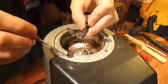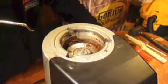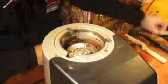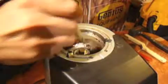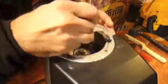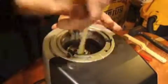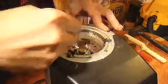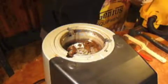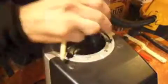We're going to have to vacuum in there. That way they don't get stuck up in the vacuum. Now the best thing is to loosen up whatever is in there. Do not introduce anything that is metallic, otherwise it might scratch the burrs and you might lose the sharpness. There are threads on the side. They need to be cleaned properly. With the vacuum, clean up the excess.